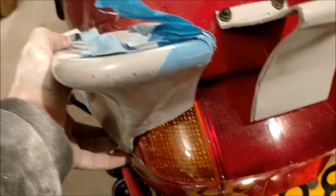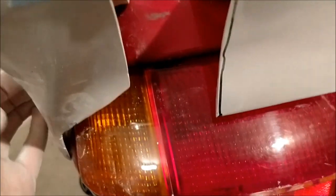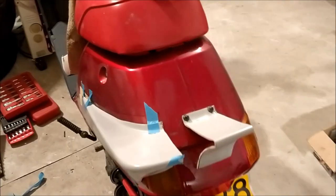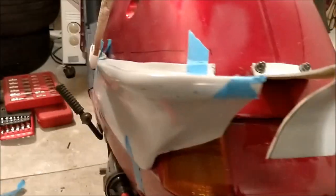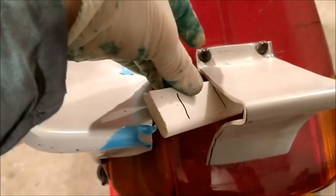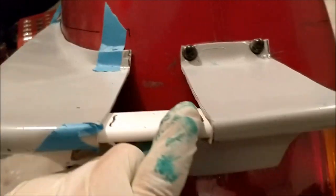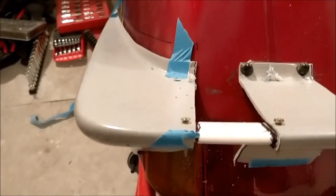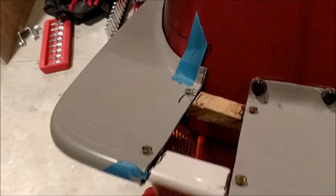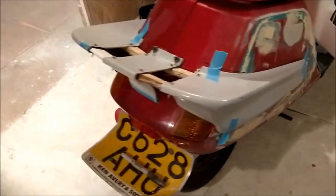So at the back — the spoiler's going to go about there, coming around and covering the backlight a little bit but not a massive amount. Going to fill in the gap in the spoiler to get it to sit exactly where I want. I've marked lines so I know how much overhang I've got each side. Going to drill a hole in it and then once it tightens up it should pull down to about there and be flat. It's in there now, nice and strong. One's done, just going to drill and screw the other one in place.